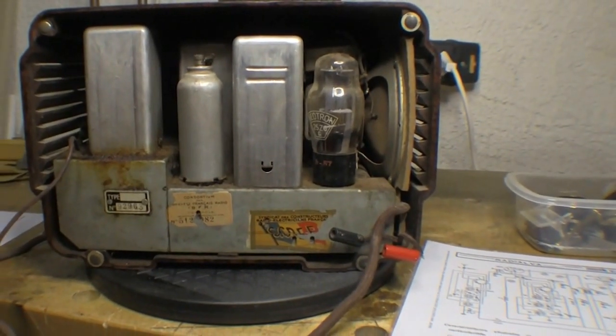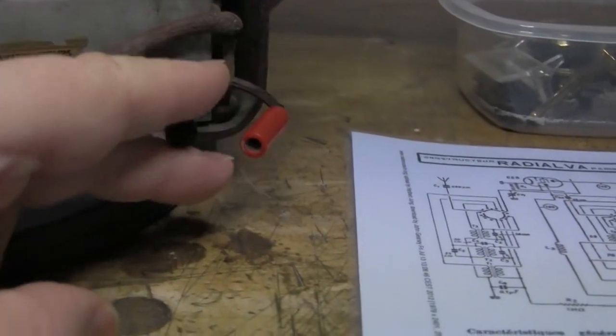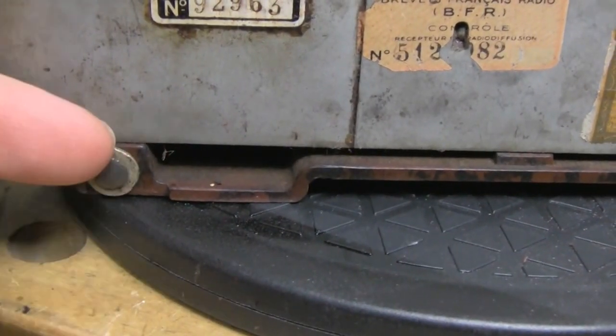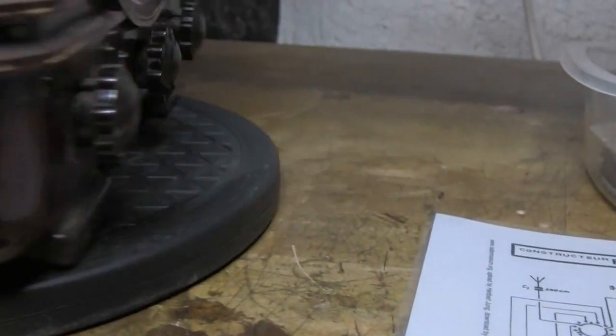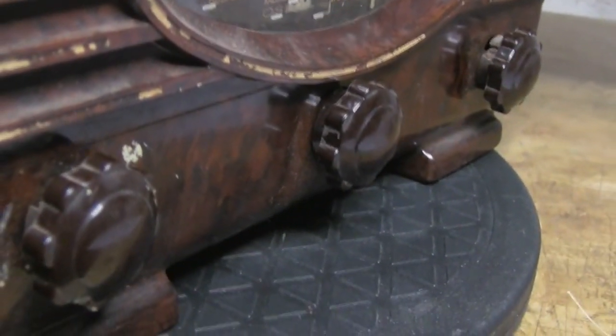Let's see if I can get this thing out of the case. I'm not quite sure what these two connectors are here, and the mains cord clearly goes in here. There's no back on the set, and it looks like these are either nails or rivets — not screws — and four of them are still there. To take it out of the case I just have to remove the three knobs, which are screwed in with screws, so hopefully they'll release with a bit of coaxing. Then there's one screw underneath holding the chassis into the cab.